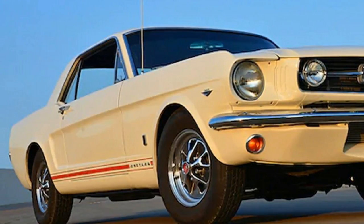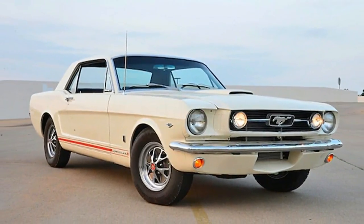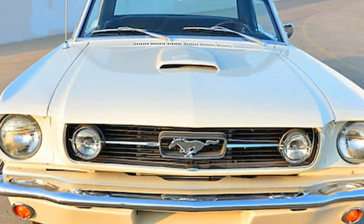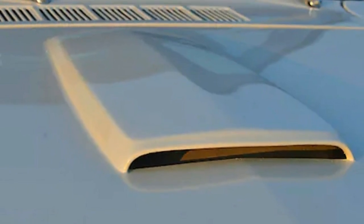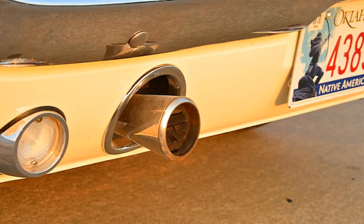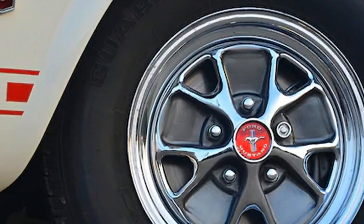"We try to take out inherent problems that were always there," Roberts said. Like the OEM brass two-core radiator — it will not flow enough water; it didn't years ago, they had trouble. Consequently, this 1966 GT cools its 289 with an aftermarket four-core aluminum radiator, readily accessible from Mustang vendors across the country. Roberts kept the GT extras but made key changes to correct those inherent engineering weaknesses.